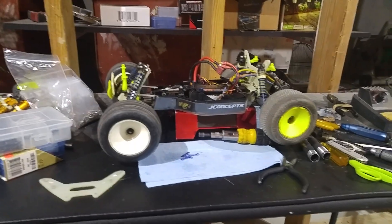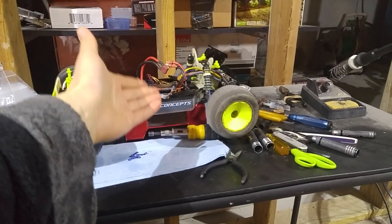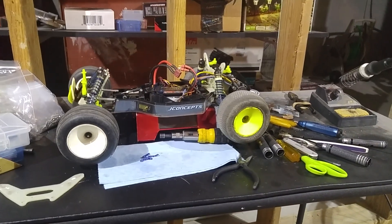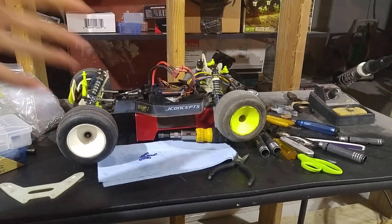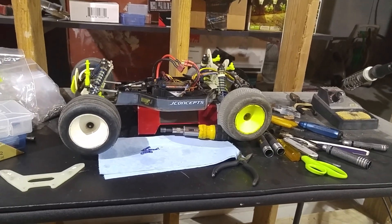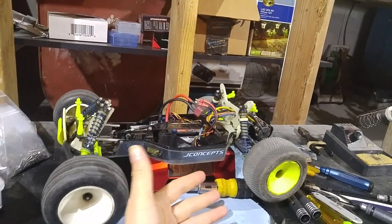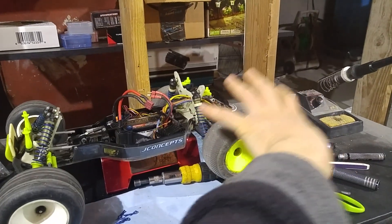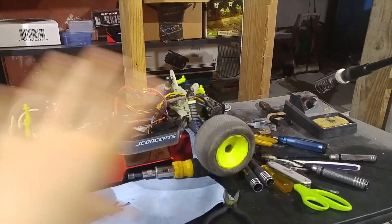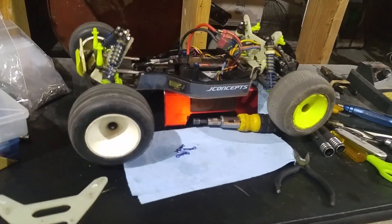I want a plush feel without the chassis slapping the ground all the time. As a side note, this is one reason I really like the Kyosho Pro XRT — it has a molded chassis rather than an aluminum tub chassis, which means it's lighter. If the chassis is lighter you're not going to have that problem, and it gives you a much wider tuning window for your suspension. The 10T doesn't have that luxury because it's a heavier aluminum chassis, and the rear end is heavier than on the Kyosho.